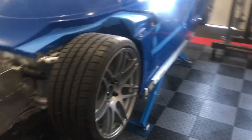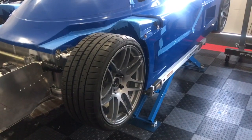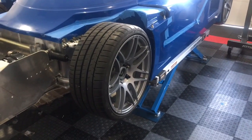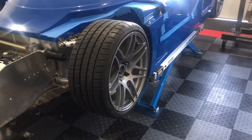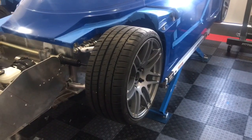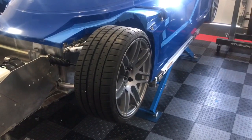I'll probably back that off to about 1 degree and there's no poke. I actually have the nose of the car on and these wheels fit nicely under the front fenders. If I centered this one in the wheel well, I get about 4.25 inches of ride height — that's about as best I could do with this size tire. The other tire was about 4.25 inches centered, but then the tops of the wheels touched the tops of the fender so I would have had to grind those out. So all in all, I think this is a decent choice.